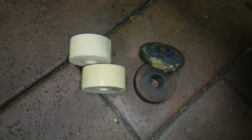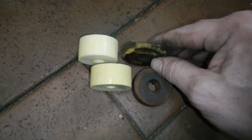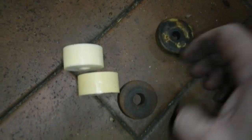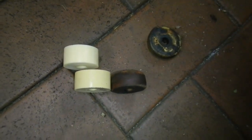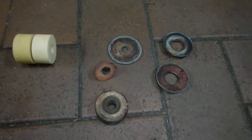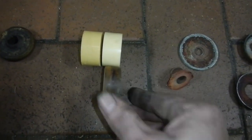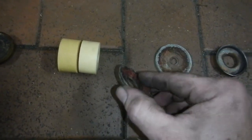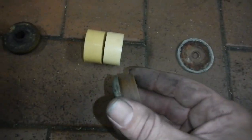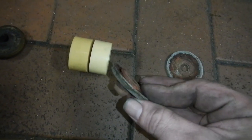Here's the new bushes and there's the old bushes. You can see that it's not as thick as it used to be — that one was bad but it's still small. Now I've got the bushes out of the left hand side; here's the new ones. This one's aged okay, this one's worn a little bit. They sit in the cups, so that would explain a clunk. Completely flat — that did a lot.